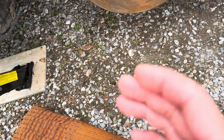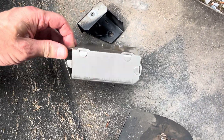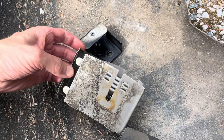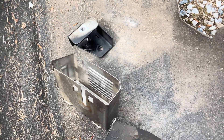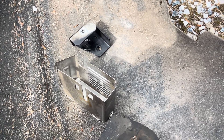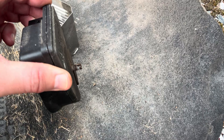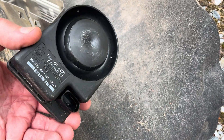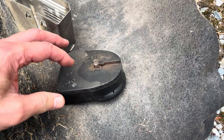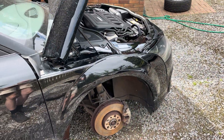When I managed to drop it down, the first thing I did was try to pull the connector out — you can't, because of the security cage around the alarm. So I levered back the tags on the side, the two on the sides and one on the end, bent that away, and with that bent away I got enough clearance to pull the connector out. Looking online, this is a common failing part — being behind the wheel arch it gets drenched in water. There may also be a rechargeable battery inside that goes faulty, causing the charge circuit to fail. I won't be refitting this; on a car of this age with the immobiliser built in, having a non-working alarm seems pointless.